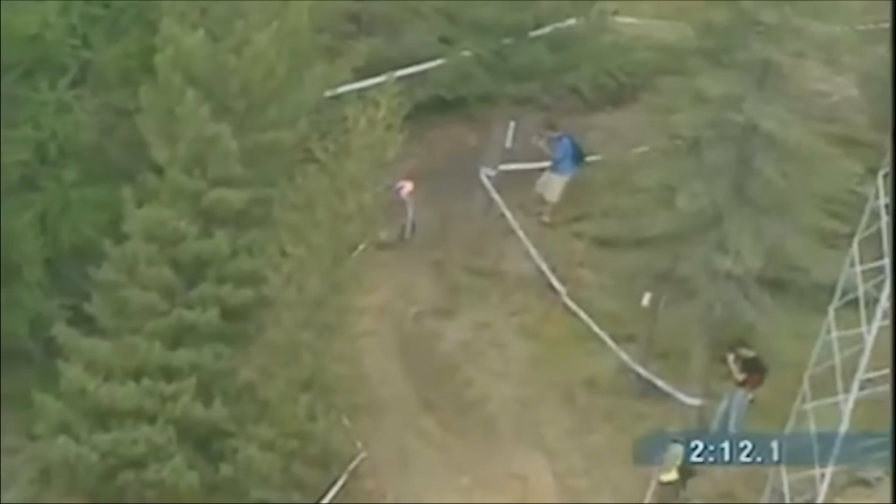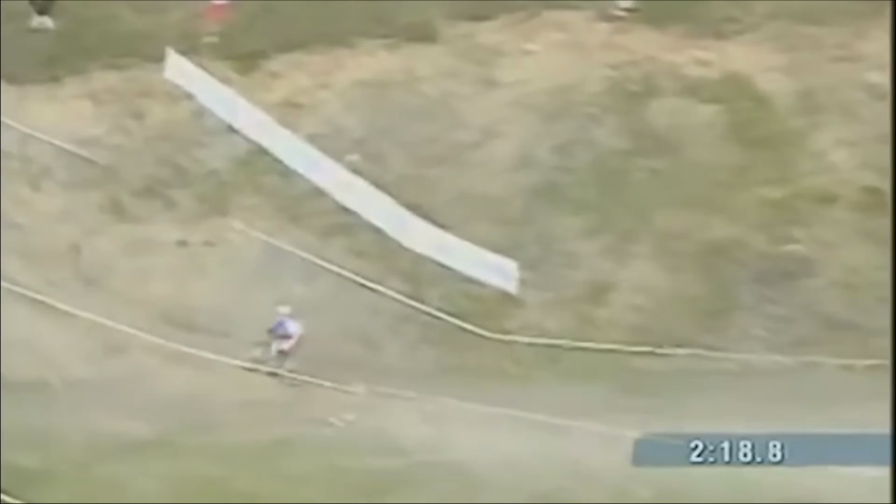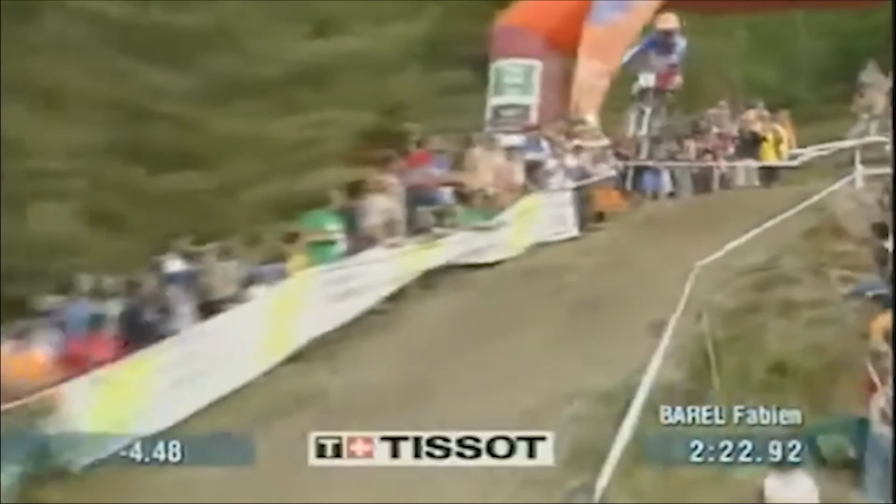So I tried to optimize the masses really low. But I also at the time had a 59.5 head angle. Which was super slack, the very first long bike as well. And the whole point was to gain stability for me to charge. The suspensions at the time had really, really little low speed, but a lot of high speed. And Jack, who is Loic's mechanic now, was behind my setup. And it was all about trying to keep the height of the suspension, but again, keep the geometry where it needed to be for me to charge and optimize the grip on the wheel.